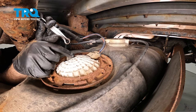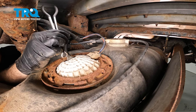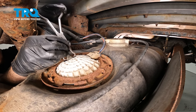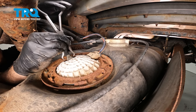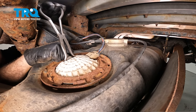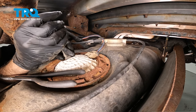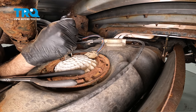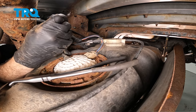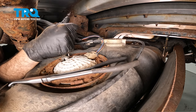On this line right here, there is a locking connector on the back side. I'm going to use these pliers to come around and push in on the little locking tab — I can't get my finger in there, so I'm using pliers. Push that in and wiggle the connector off. If the pliers don't work, you could use a small screwdriver — simply push in on this and it should unlock.